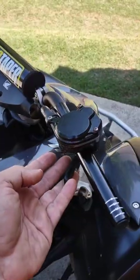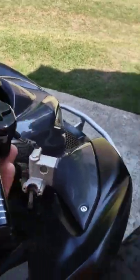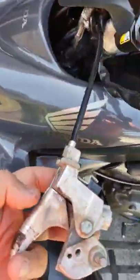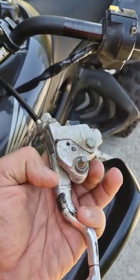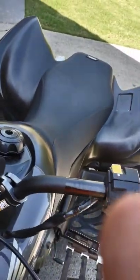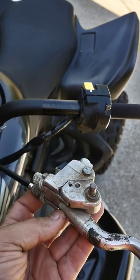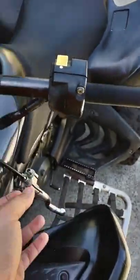To start, use your 8mm to pop that off — there are two 8mm bolts and also two Phillips head screws on the bottom. The old brake and parking brake assembly is basically not going to be used other than the cable itself. I replaced the cable with a new one. I'm deleting the parking brake, so all that system goes away. At the rear brake there's also a little part to take off and a spacer to put on, but that's for another video.